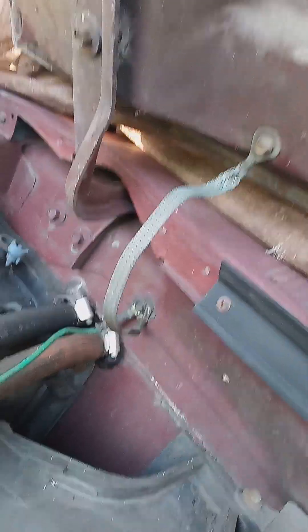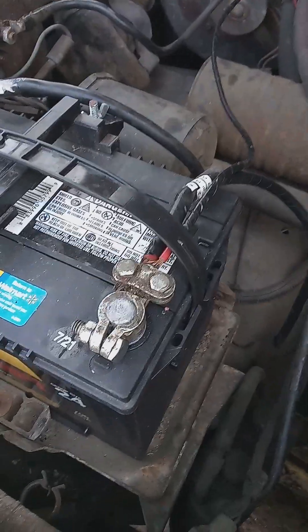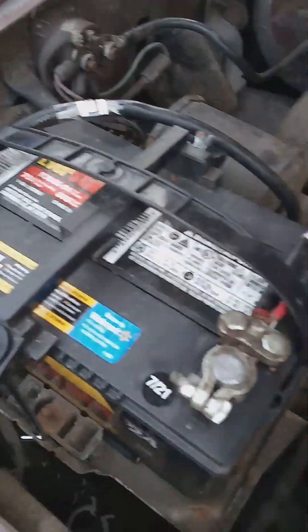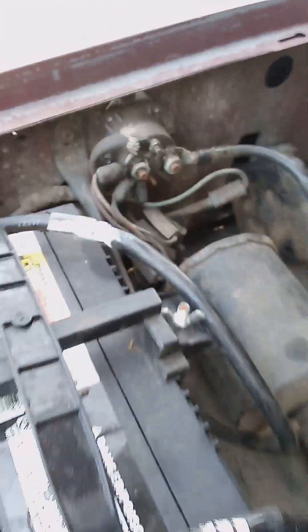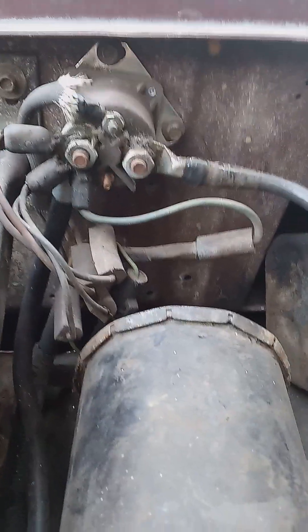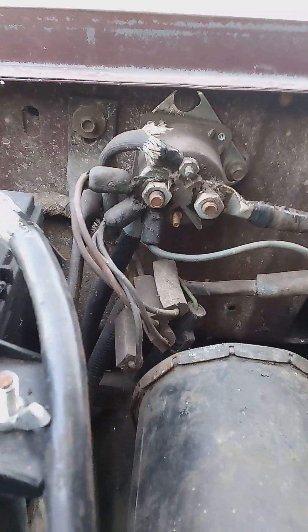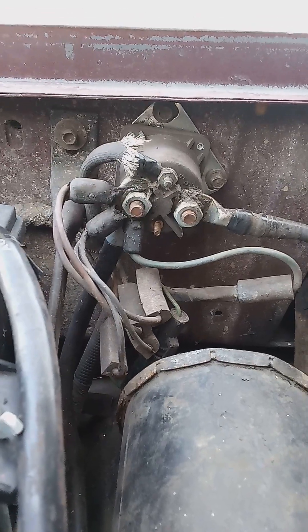So if I had some lights in my hood and connected the negative side of the light to this hood, in theory that would be a ground source. There are all these grounding jumpers in different places, and that's how the ground system works. Rather than run an individual wire back from every electrical component in the truck, things just get grounded to the metal of the frame. I hope that helps people and takes some of the mystery out of it. It's hard to explain in an internet setting in words and pictures without actually having a video, so thanks for watching.